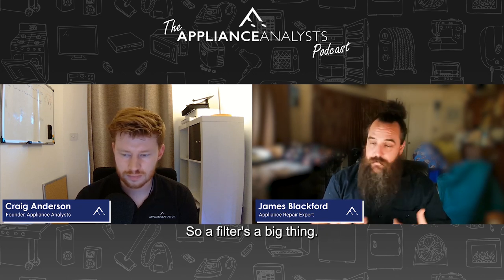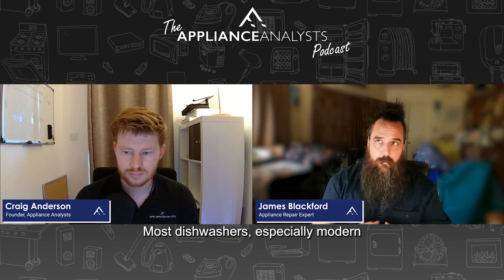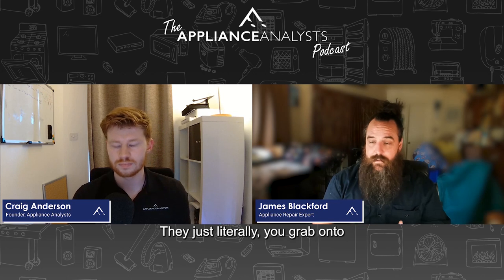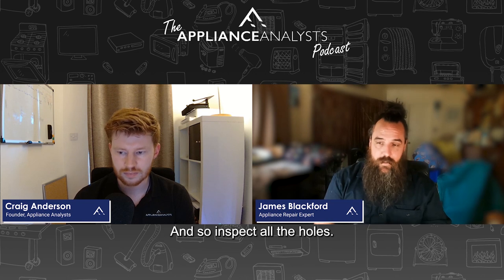One of the most common reasons dishes aren't getting clean is just due to poor water flow. So a filter is a big thing. If your filter is completely clogged, your dishes aren't going to get clean. You also want to look at your spray arms. Most dishwashers, especially modern dishwashers, both the lower and the upper spray arm come off really easy. You just grab onto it and give it a quarter turn and then it just comes right off. And so inspect all the holes.